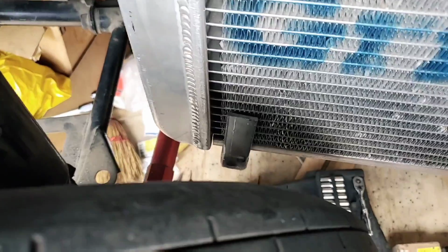After that point, I got up, and after I got myself situated, I went to look at the first bracket that I put up there, to see how much clearance we had with the passenger side wheel. I didn't like how much clearance we had. There was a little bit, but not enough for me to be comfortable with. So I took down the brackets, cut off the 1-inch square steel on the end, and re-welded it up with a 1/8 inch thick plate steel, so that we had a bit more clearance. I'm going to show you what I'm talking about.